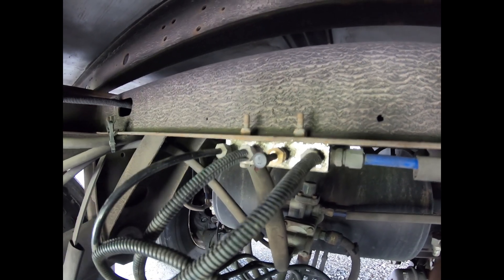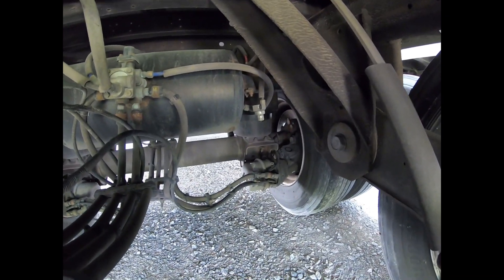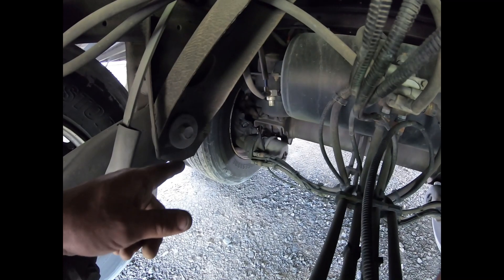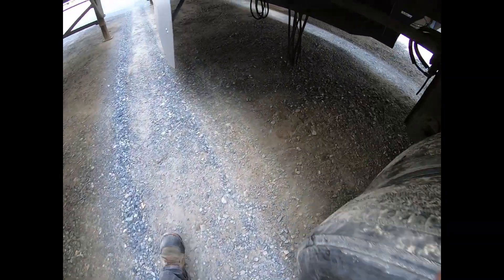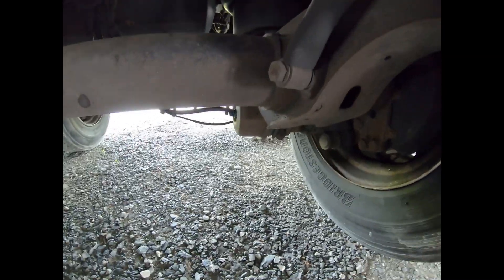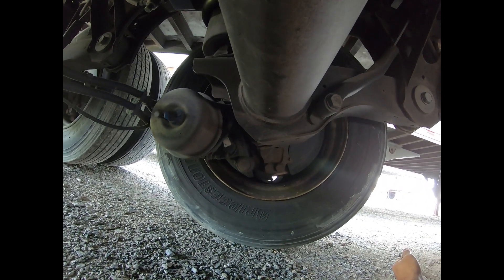I set my trailer brakes and installed this plug on the port going to the hose going to the right side of the axle. The hose feeding the left side hubcap is still hooked up, so I'm going to go up front, hit the supply valve, open it up again. If the air leak is still there, we know the left side is the problem. And if this plug stops the air leak, I'll know the hubcap on the right side is a problem. Still got the air leak. So the fact that I plugged off the line going to this side, and the only other line going to this axle is the one that's still hooked up, then we know this hubcap is the one that's leaking.